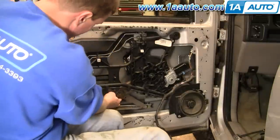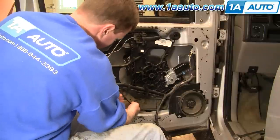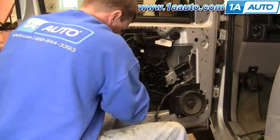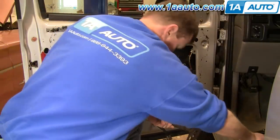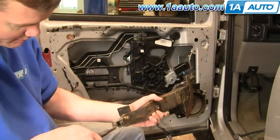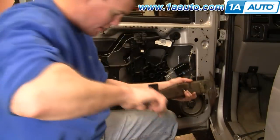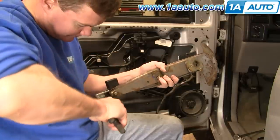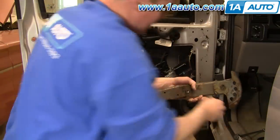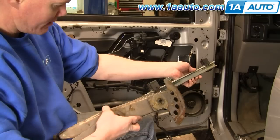That allows your regulator to come down. Right here it's in another track — you just need to slide it back and out of that track, and the regulator comes right out. Now take either your big pliers or needle-nose pliers. The regulator has been crimped on the ends, so you have to bend that back out to release the crimp on that track. Just keep in mind which way this is going. Then slide your regulator out.